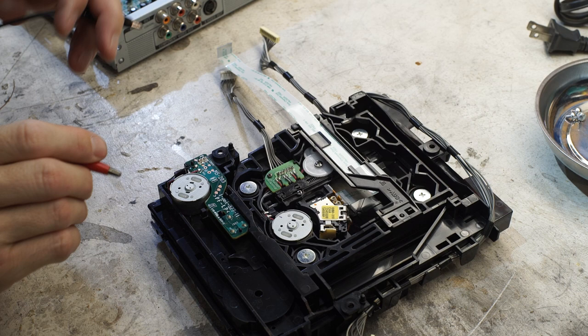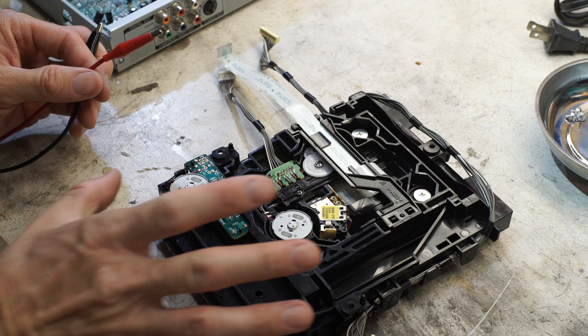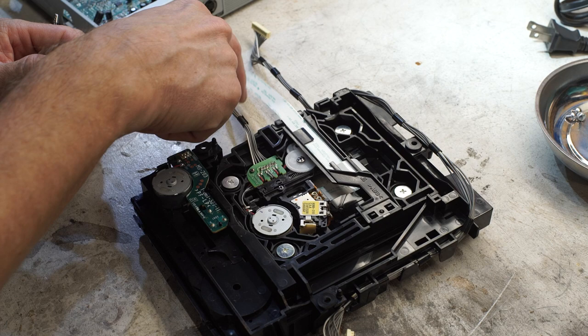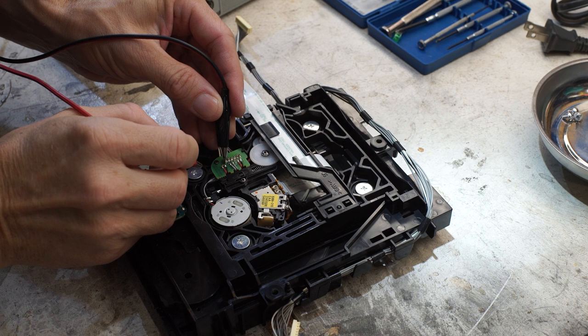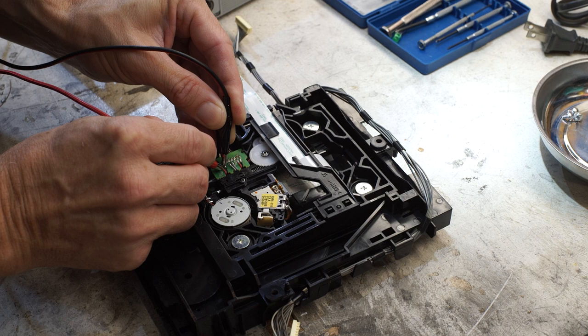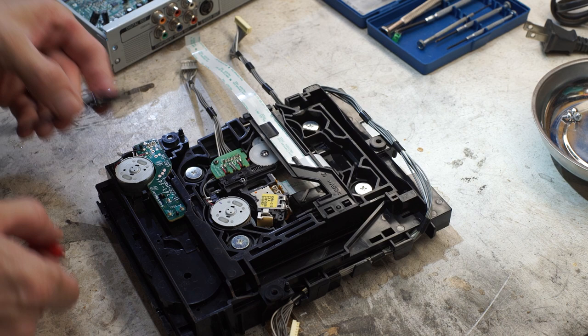We can verify this — it's a five volt motor. Obviously one is working properly; can we verify the other one the same way? If we can verify whether it's a supply problem or a motor problem — it's probably a motor problem, that's the mechanical part. Let's find out. We're going to apply five volts directly to the spindle motor. We're getting nothing, not even any draw on the power supply. I think this motor is just bad — that's pretty cut and dry. We'll try reverse polarity just in case.